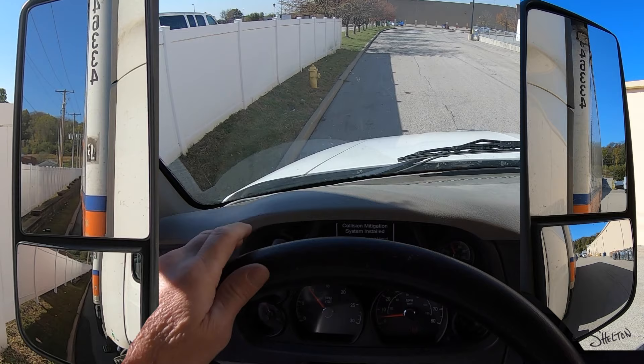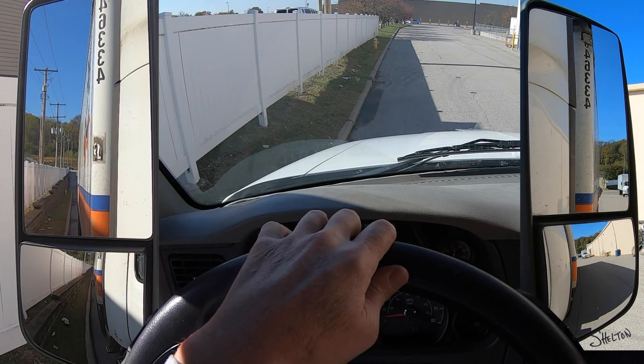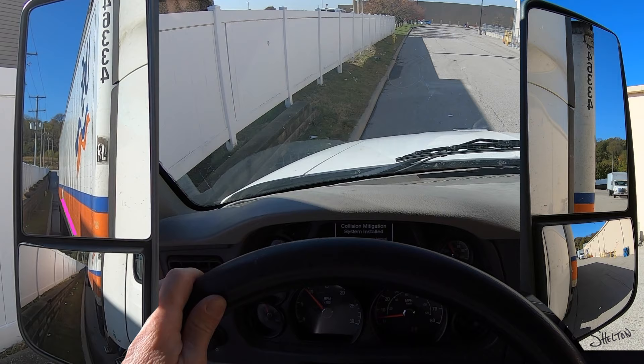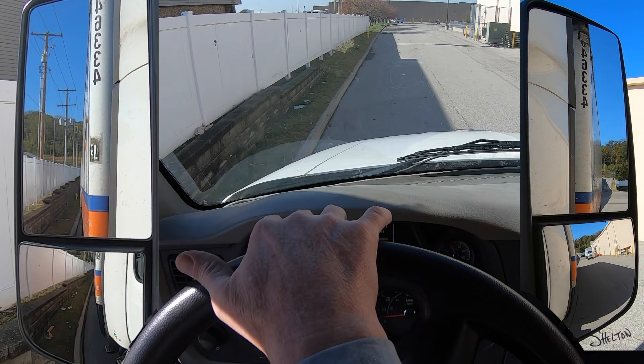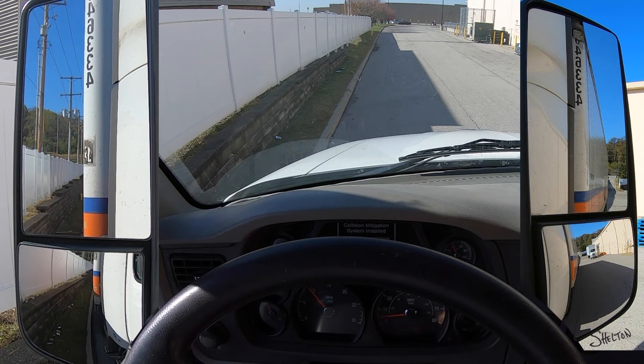I'll repeat those same things: assess where my tires are, where the trailer is pointing, and pay close attention to how the front corners are moving so I can make quick minor adjustments. I can get my tire a little closer to the curb by pushing the corner over and getting the trailer to point towards it. I'll give it a little time to travel, then push the front corner back over and make the bottom edge parallel to the curb before it gets too close. Finally, I'll get my tractor back in front of the kingpin by balancing out the amount of sidewall visible on both mirrors.